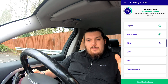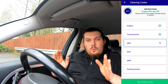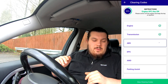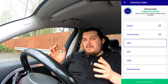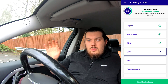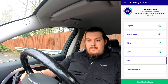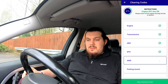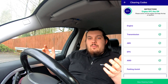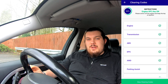I was a bit annoyed about deleting all that footage because it was quite a fun job to do. We went for a full new set of front discs and pads and they are brilliant — the car's so much better with far more responsive brakes. Interestingly they wore far more on the inside than the outside, so if you're checking your brake pads, make sure you feel the back of the disc. We've got Brembos on the front and Brembos on the back — four Brembos all round — and they've performed brilliantly. I've done about 3,000 miles since putting them on so they're well into their bedding-in process now. Before you were getting a horrible grinding noise and it just wasn't fun to drive, but now it's a far nicer experience.